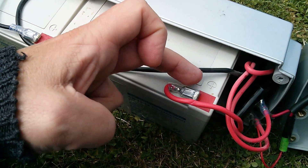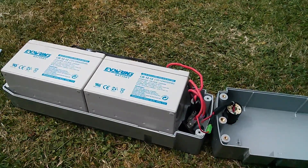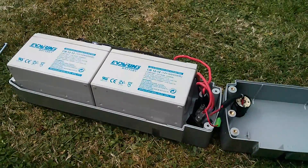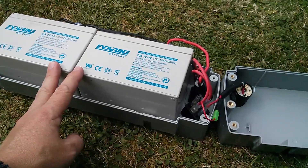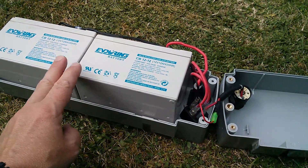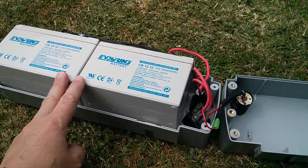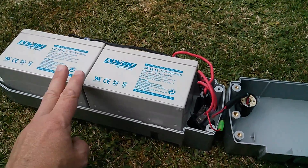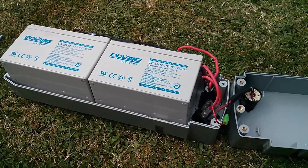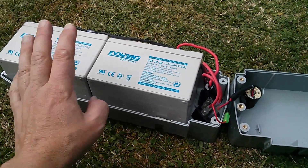If you wanted to replace these batteries — and they do need replacing — you'd have to battle with those soldered terminals to get them off. The problem with this battery is that although the bike performed quite well when new, these batteries have degraded, probably because they weren't charged properly. They were left to stand, the voltage dropped, and they degraded. Now the battery isn't very powerful and doesn't have the range or running time it used to.